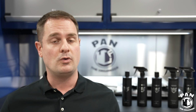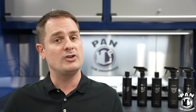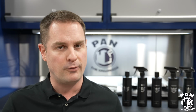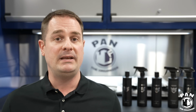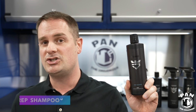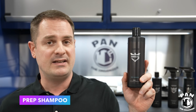Before you apply the coating, of course, it's always the best practice to do paint preparation. The more time you spend prepping your paint, the longer the protection is going to last and the better it's going to perform. So the bare minimum you should do if there's nothing on your paint, meaning no protection, no previous wax or no sealant, would be to use their prep shampoo. This is basically what we call in the industry a stripping shampoo. So a heavier concentration of the detergents in there, so stronger cleaning power to break down and to remove any previous waxes or sealants, especially older waxes and sealants.